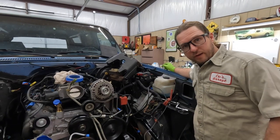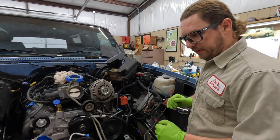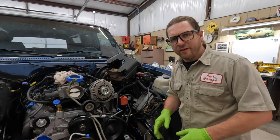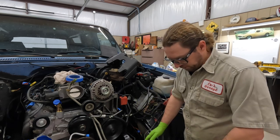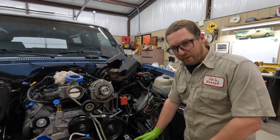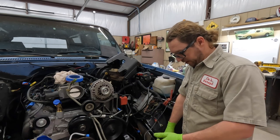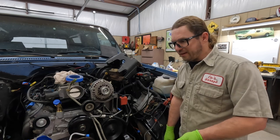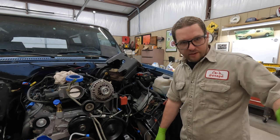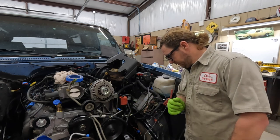Welcome back to another day in CW's garage. Today we're going to put the core support on, but first I need to put a new steering gearbox in. The old one was pretty loose and Serena didn't really enjoy driving it because it had a lot of play. I bought a Borgeson — emptied out the bank account a little bit — a very nice brand new steering gear with a quicker ratio, 12.7 to 1. I ordered it yesterday and it's already here from Summit, which helps since I live in the Metroplex area near one of their warehouses.